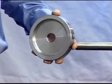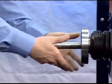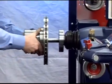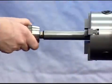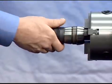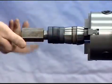Install the backing plate under the brake lathe arbor with the offset facing outward. Install the double chuck with rotor or drum under the one-inch arbor. Use the spacers supplied with the brake lathe so that it extends out to the arbor threads, then use the arbor nut supplied with the machine and tighten the nut against the spacers.